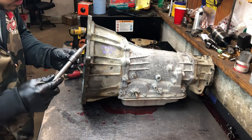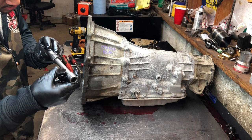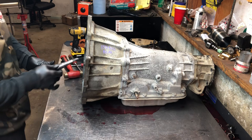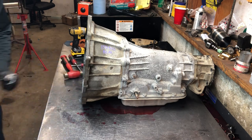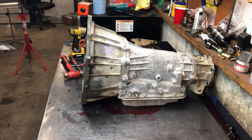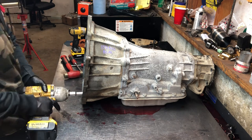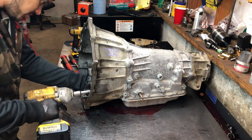This is a T-50 Plus — it's a special Torx tool. It goes here to take these bolts out. Press hard because these things, the heads like to strip on these. When you strip a head it's not fun to take out.